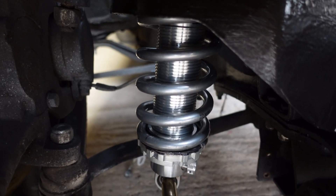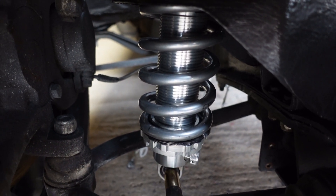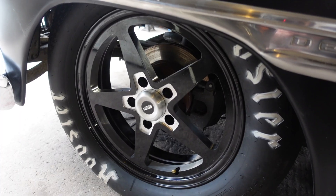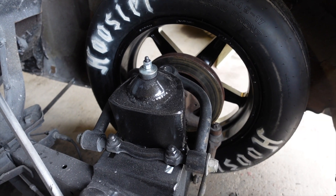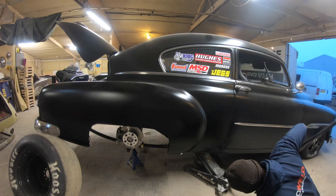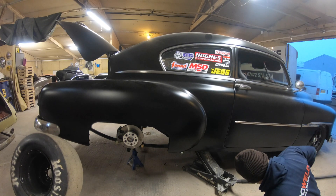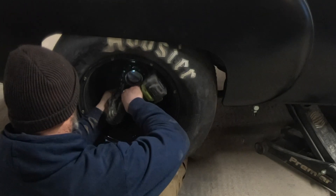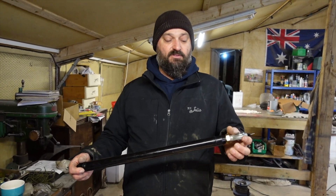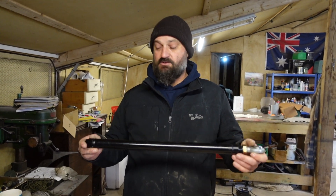Suspension, steering, brakes — all done, moving along pretty nicely. Got all the wheels on the car now, got the new slicks or the new bias plies for the front, suspension's in. We moved the rear axle back about an inch because it wasn't directly centred on the wheel opening. So those four-link bars — those CalTrac bars — are on today. But because we moved it back an inch, by the time you wind these out I wasn't happy with the amount of material that was inside those tubes.